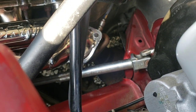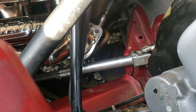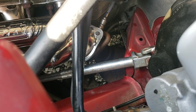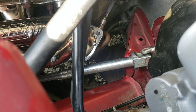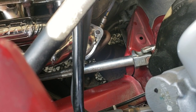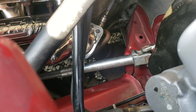I mean, you could probably do it with 3/8 stuff, maybe with a 3/8 breaker bar, and get up in there. But everyone's might not be as tight as mine, and I could also see a scenario where some of them could be longer. I've even had stuff like that round off before, and it was a nightmare. If that happens, you're going to need Irwin bolt extractors to get it off, and it's still not easy.